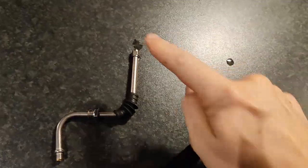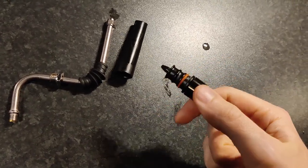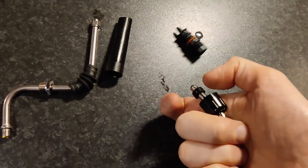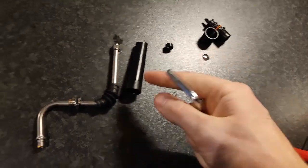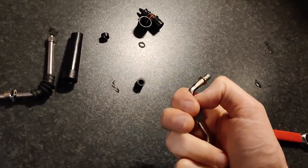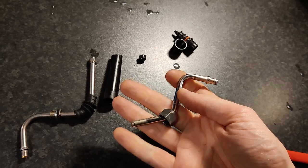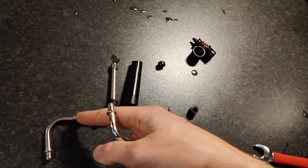Then, when you've done that, you want to get your two steam wands and swap the bolts over. Which basically means popping everything off — so that pops off, this unscrews at the top here. Then this pops off, a few other plastic bits. There's one, there's another one in there, a piece of rubber — basically push it and it'll slide the rubber off. Then your bolt will come off this. Now it won't come off easily; they're quite tight bends, so you have to clamp it and twist and whack it a bit. And if you don't care about the steam wand, you can just bend it straight and then it'll come straight off. I did bend this one a little bit — still usable — just made it larger than 90 degrees so the nut came off.